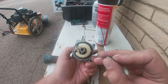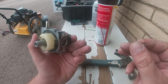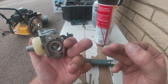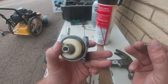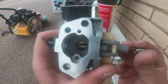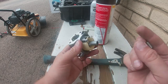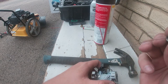Here's a tip: if you don't want to remove the jet and you're worried about breaking that brass piece, find a spring with real thin wire. You can also buy micro drill bits — I'll have links in the description. I just cut a piece off a spring with some dykes so I can get in there and clean out that jet. Once you spray a little bit of carburetor cleaner in there with this, you can see it goes all the way through. That jet is cleared out. Guitar string works too if you have that.